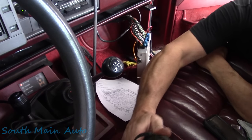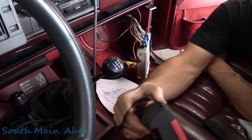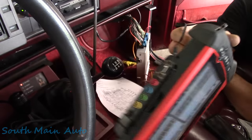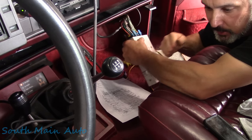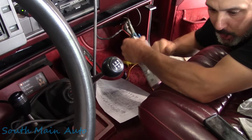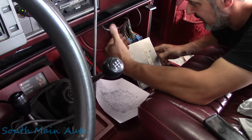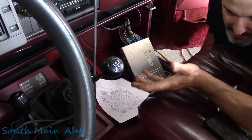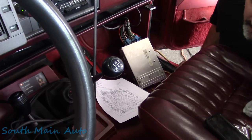Oh wow, oops, you just missed it. It was just saying that our battery voltage was 25 volts just moments ago. There it is, 25.5 volts is what the battery voltage is. So something's definitely wonky inside of here. Give it a sniff, but honestly, all it smells like in here is mouse piss and cinnamon. But yeah, the voltage is all screwed up now on here. And all the other sensors keep switching to zero. And our RPMs are at 1,900.